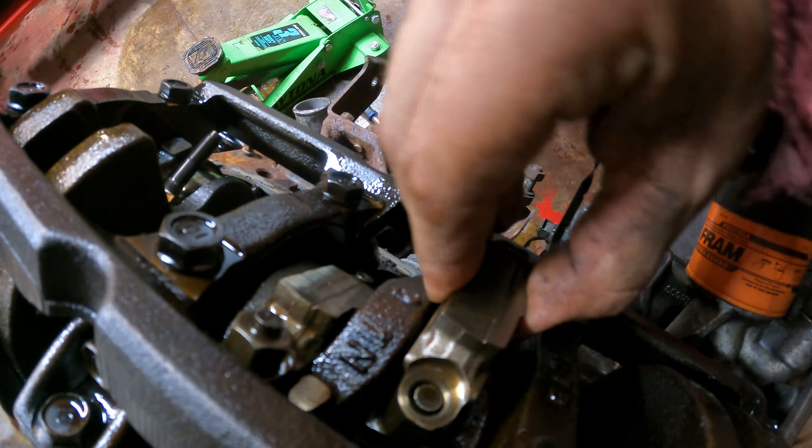This main does not look good at all — there's a complete wear mark right in the middle. You can feel the damage with your fingernail on another one — no bueno. Also found out this is a non-forged cast crank, identifiable by the arm shape.